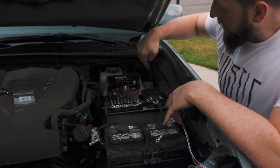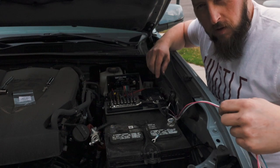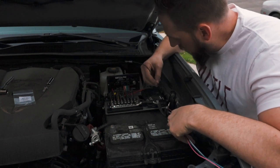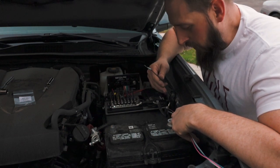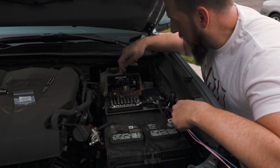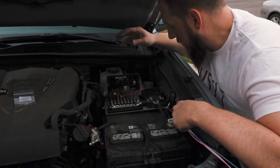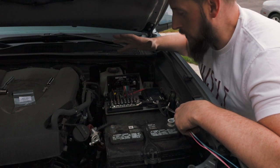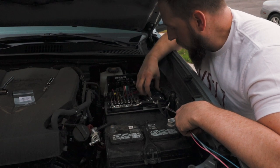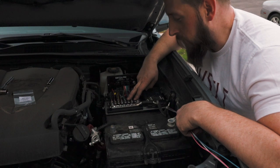Next steps are going to be going through the firewall to put the switch connection in there, and I'm going to have to double check the wiring diagram. What we can do is hook up all of the ground and then start hooking up all the power — probably except for the Switch Pro for right now. We'll go ahead and add the power to the breaker and button this all up, and we'll be good for future accessories — connecting what we need to the fuse block and to the Switch Pro controller.